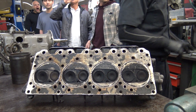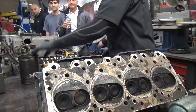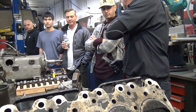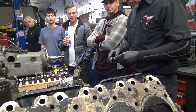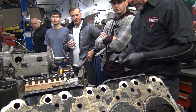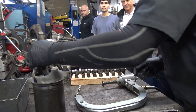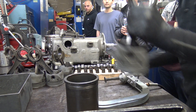I was going to measure pistons just so you guys can see that. So 4.1 — and this is not the most accurate tool, it's a cheapo, but it still works. Remember when I put this in here, it didn't rattle around. That one's a good type — it's almost zero clearance.